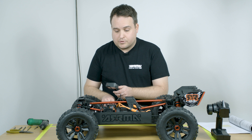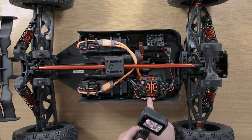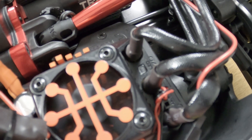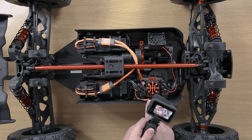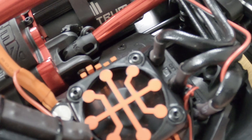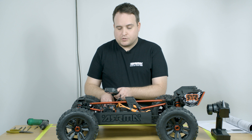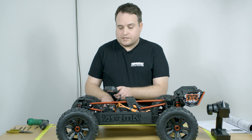So I will go to variable number two, which is the motor direction. Press the set button twice — now there are two green flashes, which indicates you're in variable two. Then you hold the set button for three seconds. Now the red light is flashing, which indicates the value you are in within the variable. Here we have two beeps, which means the motor is in the clockwise direction.